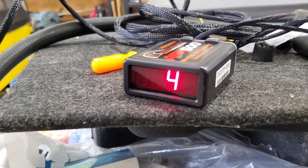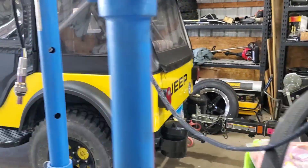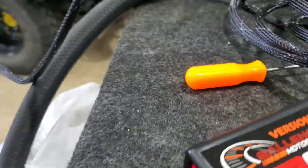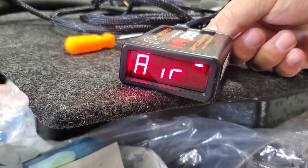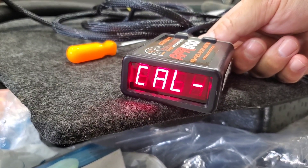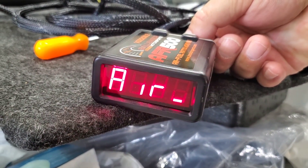Here I got it powered up. It's just counting down — it's probably going to say Cal. The O2 is hanging in free air. It looks like if it's calibrated for one setting, it's calibrated for all of them. There's this black twist knob — you see how it goes down and then up. You want to turn it so it's right in the middle, and then it's calibrated. I turned it all the way up — it says 20 — so that means the max is going to be 20. We know that putting that jumper in got me where I wanted to be.